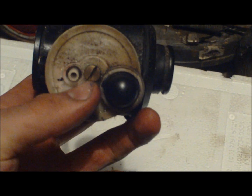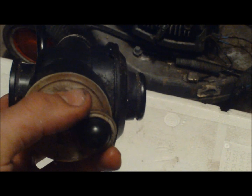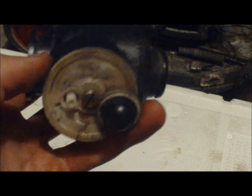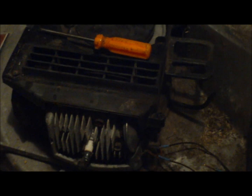Taking that off is pretty simple — pull the screw out. You'll see there's only a few parts inside: you've got your float that sits in there, your needle, it's all plastic. You've got an o-ring around there — a lot of the time if you take it apart it will need to be replaced. You've got your decompression valve hose, kill switch goes in there, and you pop that wire for the throttle back in. I have to investigate further to see why this isn't running.